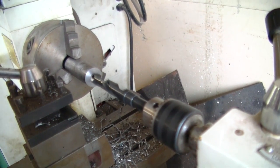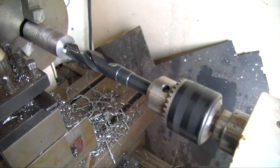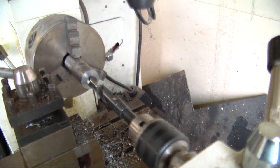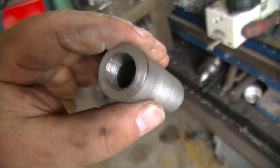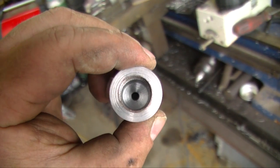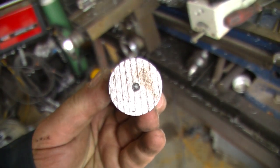I've got a 5/8" drill bit — that's not the ideal tap size but for an 18mm tap it'll do. I'm gonna punch through a 5/8" hole deep enough for the O2 sensor, then continue on the other side. Hopefully I made this the right length — it's gonna be pretty touch-and-go but we'll see once I drill the hole through.